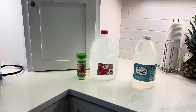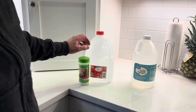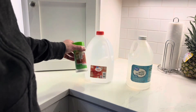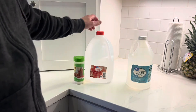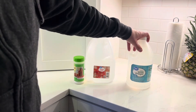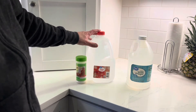Descaler solution is about a 7% solution of citric acid in distilled water. That's plan A because citric acid works much better as a descaler than plan B, which would be to use white vinegar. So if you happen to do some jarring of fruits and vegetables, you might have some citric acid handy. You might have some distilled water for ironing. If you don't, you can just use distilled white vinegar as a descaler for your coffee maker. We're going to use distilled water and citric acid because that does work better.